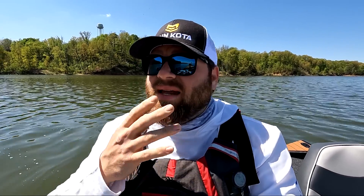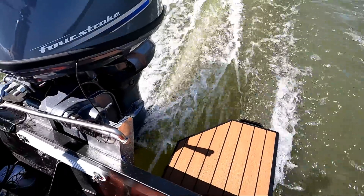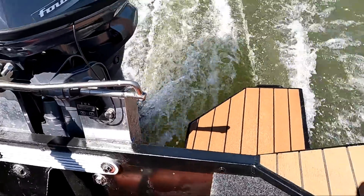I'm also considering lowering the engine height again. Right now I have it in the middle mounting hole, and the cavitation plate is dead even with the bottom of the boat — that's technically where you're supposed to have it — but I do have pods on the boat which tend to keep the boat higher out of the water in general. So going down a little bit under the boat is going to help, because as soon as I start to apply any power the engine just starts sucking air. It's hard to see while you're driving, but as soon as I apply power the prop just sucks the water in and then starts sucking air, even at a neutral trim position. In order to run it as it currently is, I have to keep the motor tucked in real close to the transom, and when I start to trim out at planing speed I either start porpoising real bad or start sucking in air. So I'm going to try a smaller prop and go down an engine height to see how that all performs.